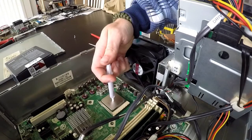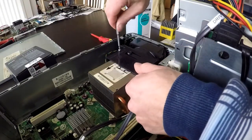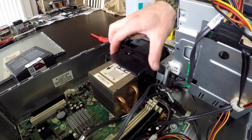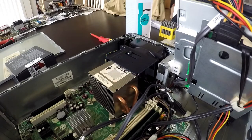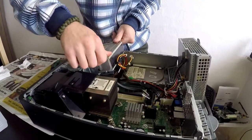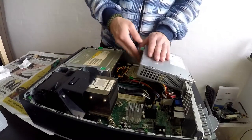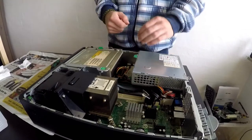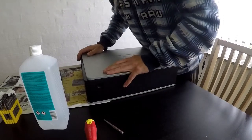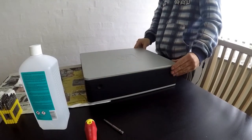Let's put the CPU back. I replaced the thermal paste with a more appropriate amount and screwed the heatsink back into place. When I went to screw the bracket back I realized the little screw went nowhere and the bracket is just held in place by the top panel — not sure why they put a screw there. There are no locking mechanisms for the power supply nor the DVD drive; these all seem to be held in place by the top panel. The top panel is very stiff and I pretty much had to put my entire body weight on it, but it closed with a nice loud snap so you'll never be in doubt whether the panel is actually on.